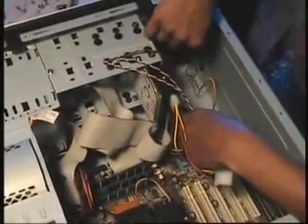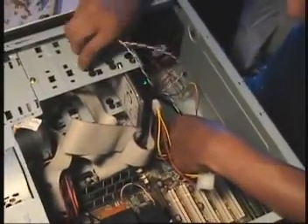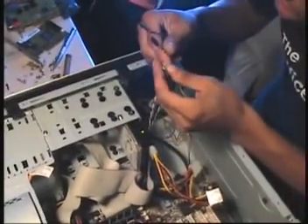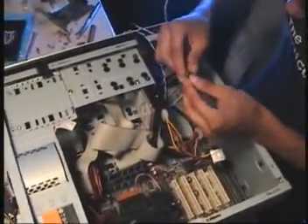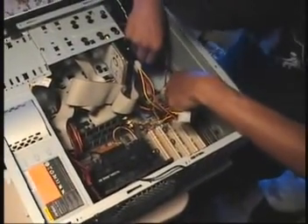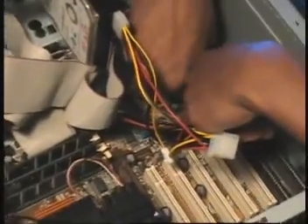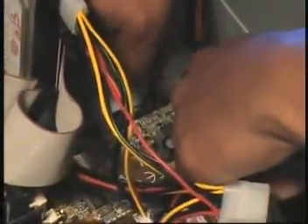Now I've got these other cables or little wires here. I want to get them on there too. Patience, patience. These are important because it's a reset, hard drive, power button. So what I have is the reset switch and the power switch and the power LED. I'm only connecting what I saw was connected when I hooked it up. We're going to put power into place, and this is really where having your motherboard manual comes in handy.